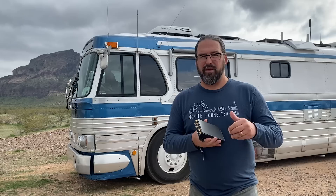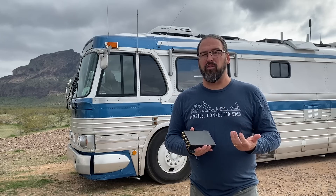We've got a whole video explaining the advantages of MIMO and why two antennas often beats one. But now there are starting to be cellular devices with support for four antennas at once, taking it to another higher level — four antennas working together as 4x4 MIMO, pulling down four signals simultaneously over the same chunk of frequency and sometimes going into a quadruple speed mode. That is still very rare for supporting 4x4 MIMO with external antennas, but it'll probably become more and more common.